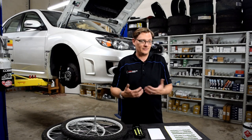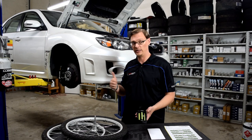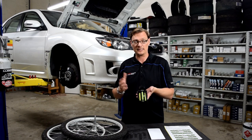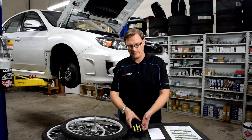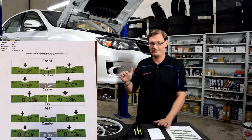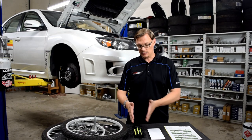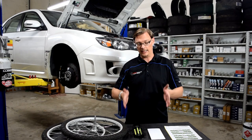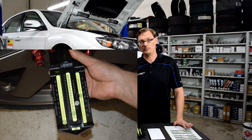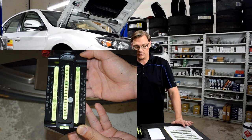It's great to show in demonstration, but how much change are we actually getting? On both Scotty's car here and our Pikes Peak car, we used a bubble gauge — not a highly precise instrument, but enough to show what's going on as you turn the wheel. Both cars are set at about eight degrees of caster and sitting at about negative two to negative two and a half degrees of static camber. We put the bubble gauge on with wheels pointed straight ahead, then did one full turn to the right, back to center, and one full turn to the left.